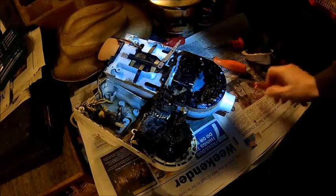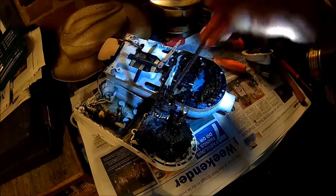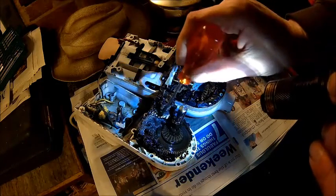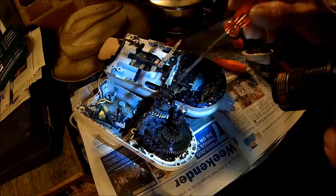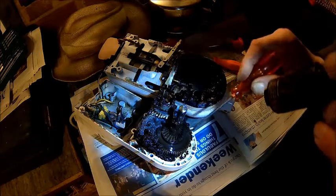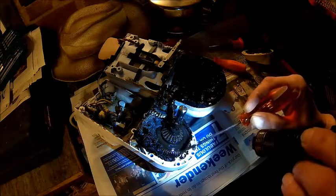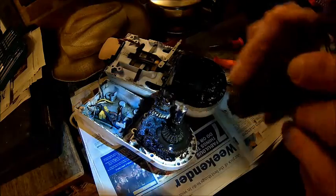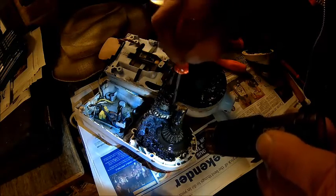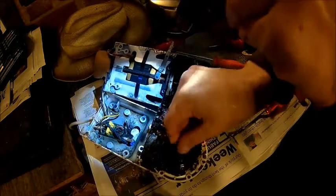Well, that's how it looks inside — it's a bit of a mess. The grease became pretty hard and there is a lot of grind, but the metal gears are all fine. It's just that plastic gear here which died. That's what it looks like. All the other gears look good to me. I think we take it to the parts washer first and just clean it. These parts are available and relatively cheap, so I'm not going to make one. All the other gears have got all their teeth, which is good. They were fairly well greased, but I think it was overloaded at some point because 5–6 teeth are actually missing here. That's our problem.